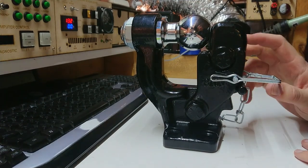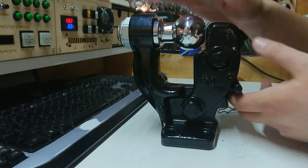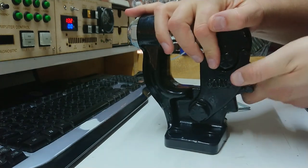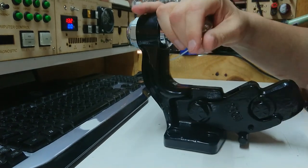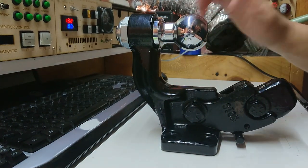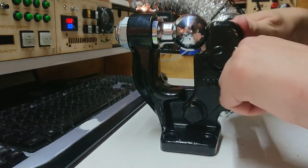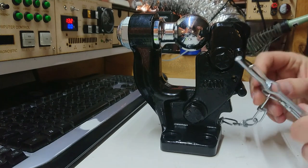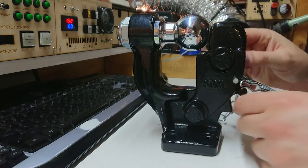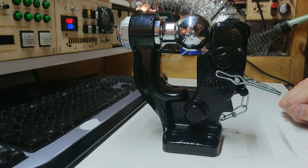Now this one's a pintle-ball hitch, which means you can release the pintle side of it. So this little lug that locks the pintle ring in, which is very tight and finger smashing. You can lock it in the up position and tow things on the tow ball if you wish, or we can lock it down with a lunette ring and a nice easy to use safety pin here, which we can drop in as well. I like that idea much better.